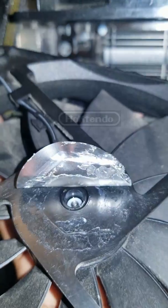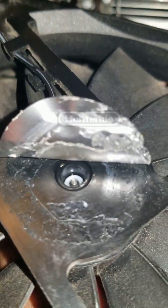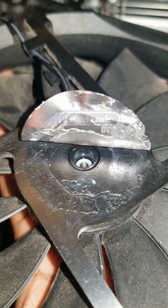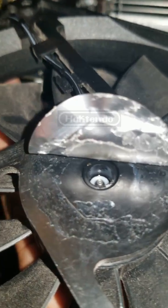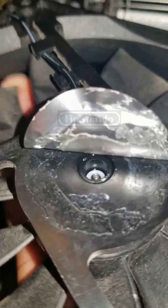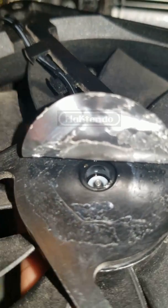When you pry it, you get this little bolt right here. If you're going to use the WD-40 or motor oil, you can just pour the nozzle of the oil inside there and just rotate the fan. Just play with the fan a little bit so the oil can work its way in there.